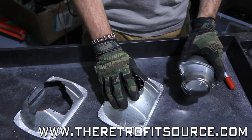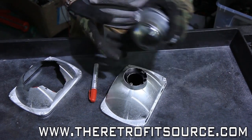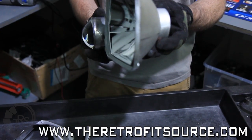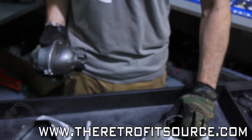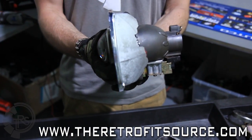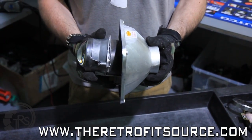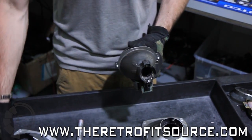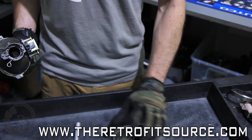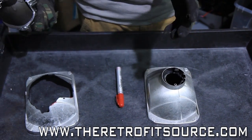Now that you've got your projector trimmed up, it's time to start modifying the housing. Because of the limited depth inside sealbeam housings, we need to sink this projector as far back as possible so the lens clears the projector lens from the side profile. That's why a large hole is required to be cut in the back of the housing. Every projector comes in different shapes and sizes, so there's no specified formula for the shape you should cut — using common sense, you can look at the back of the projector and the back of the housing and see the similarities. We recommend getting out a Sharpie marker and drawing a small hole in a rough shape, then enlarging it later, since it's hard to put material back once you've cut it away.